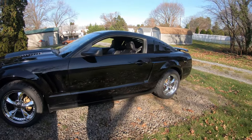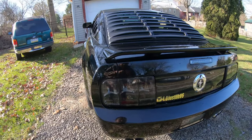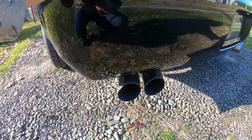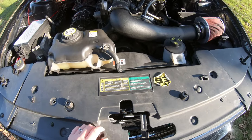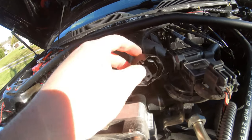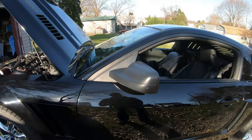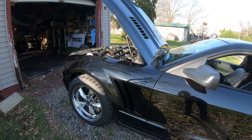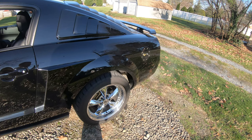She survived the drive. Here's the idle chop after driving — it's not as aggressive as I actually would like, not as aggressive as before. So I did figure it out: we do have a leak. We drilled a hole just big enough for our little tube here. After further investigation, even putting my hand and completely blocking off the EGR, it's still pulling air from somewhere else — somewhere out of my control. So this is the best we're probably going to get.